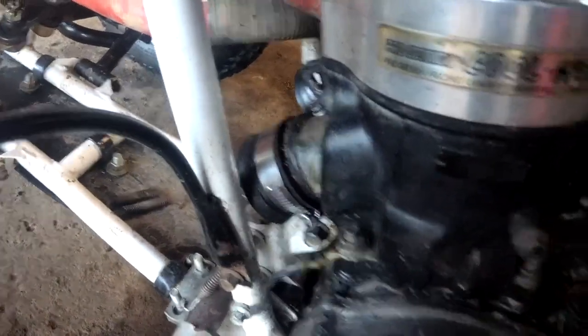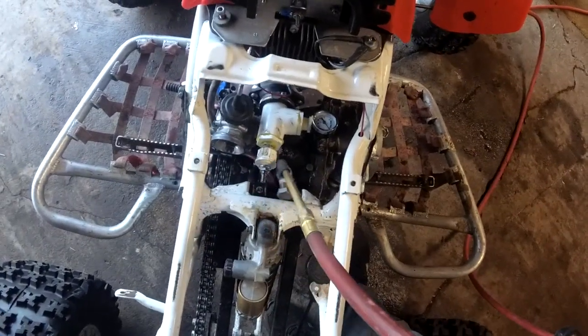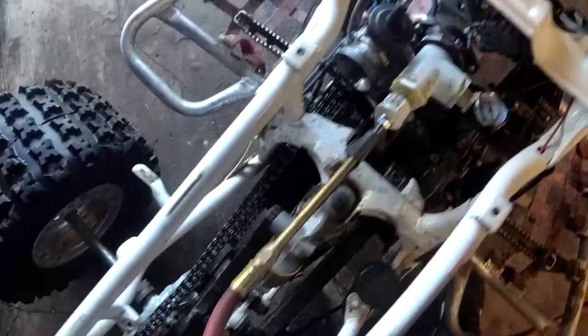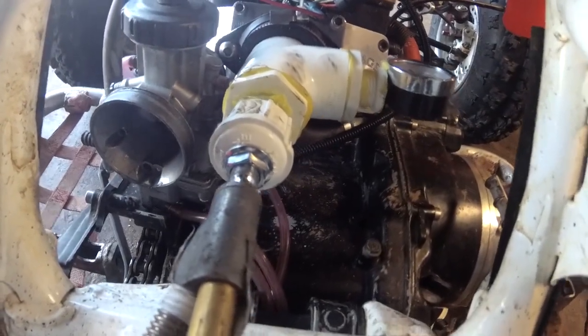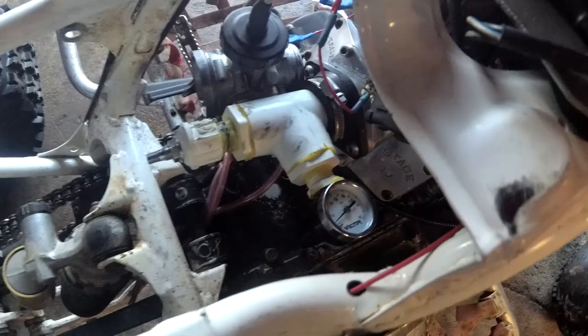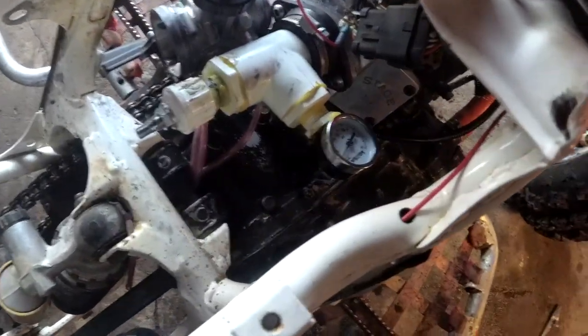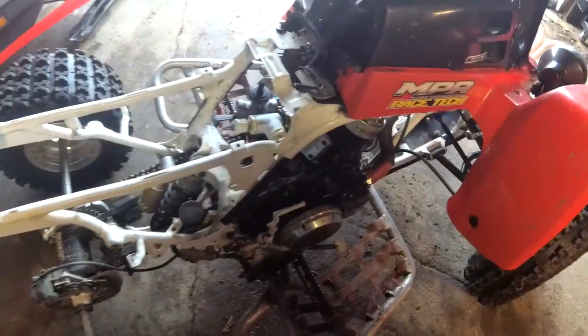You can kind of see that there — that one and the other plug. Once you've got those tightened down and your intake is tightened down, go ahead and pressurize. I'm using a compressor — you just got to be careful. A bike pump works too. You're going to want about 5 psi. Keep it under 10 pounds, but 5 psi is about what you want. Just get a little pressure in there. There we go on the gauge — it's like 6 pounds in there. About 10 minutes would be really ideal if it holds the pressure for that long.